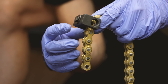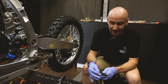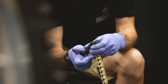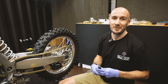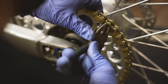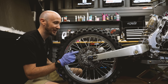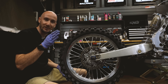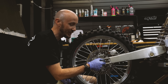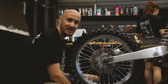We're just about to break the chain. I've got it marked and taken it off — using the Ballard's chain breaker. It's just a matter of holding it with a 17mm and driving the pin down with a 14mm. I've got the chain on and the joining link in — we just need to do up the clip link, using these clip link pliers which are elongated and shortened on one end. Lining up the wheel now. It's really important to keep the wheel centered and aligned so you get nice even wear on the chain and sprockets. Using the new chain adjusting blocks, the indicators are really obvious compared to the OEM ones, making it easy to keep the chain adjusted and level. Three fingers is the rule of thumb for chain tension — too tight and you'll put too much stress on your gearbox.